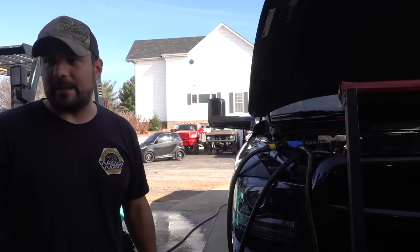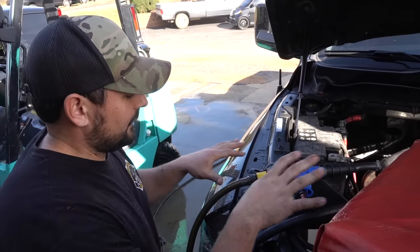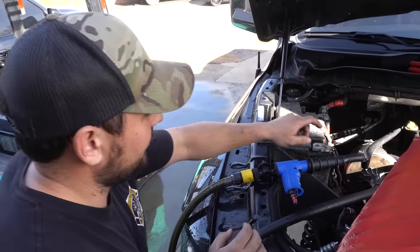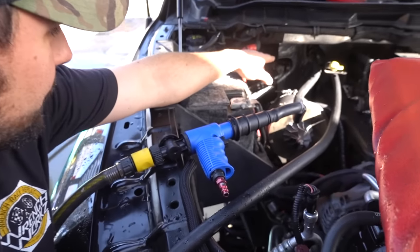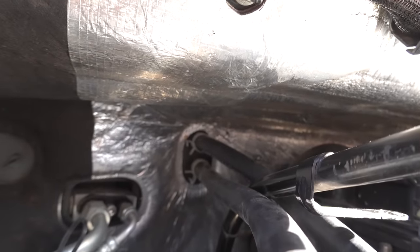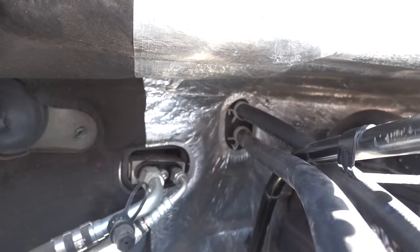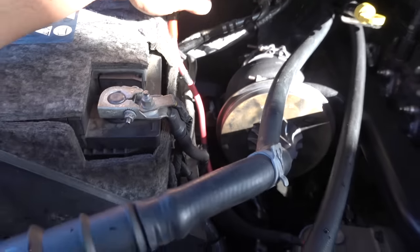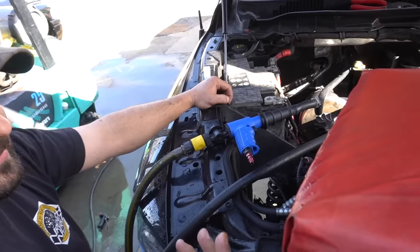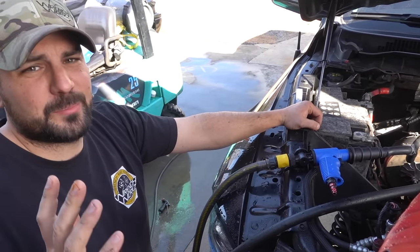Real quick rundown before we cut water and shop air - if you guys are wondering how to do it in reverse: the bottom connection is the reverse inlet. Flow normally comes from the cylinder head into the top one and comes out of the bottom one to the lower outlet piece. So to flush it in reverse, you go down then up versus the normal path. Hopefully that helps if you have a similar heat issue - this is not a confirmed fix, but we did get stuff out of it.